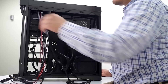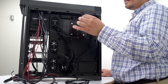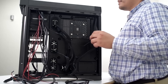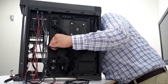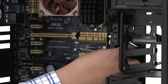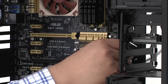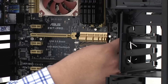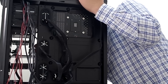First up, we've got a SATA cable, and that's going to be for this top portion right here where we have the ability to mount a drive. We need to provide data to it, so we'll run that to one of the actual SATA ports. For the fastest performance you'd use the primary SATA 6G, and for very fast but non-critical performance you could use the supplemental secondary SATA controller. For mechanical drives both are essentially transparent, but with an SSD you'd see more of a differential depending on the controller.